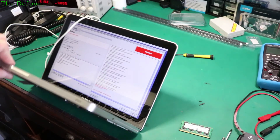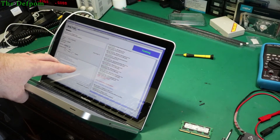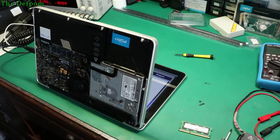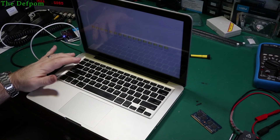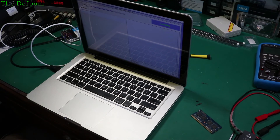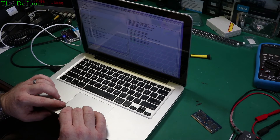The test has just finished and it failed. It says data match failed — it's still got memory test failing. So that module may be no good, or it could be the RAM slots themselves. We'll try another module in there. So I'm just booting up off the DDR3L instead. That failed that one test. I did try putting it in the other slot and it just said no. I think the other slot is bad — I think the top slot has failed. So we'll see how this goes. I'm just going to do only memory tests and leave that running for a while and see what happens.